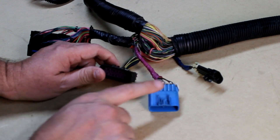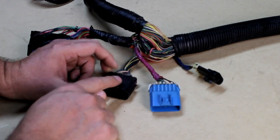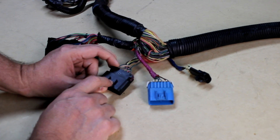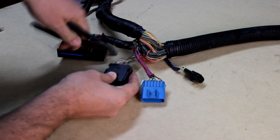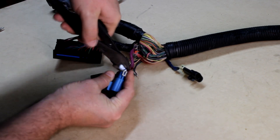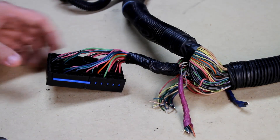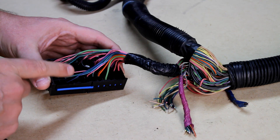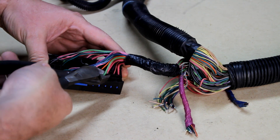This is called the C100 connector, this is C152, and this is C153. I'm gonna cut all these off the back. Those three or four wires on here I'll find them coming off the pin outs of my PCM connector, so I don't need to keep track of that — we're just gonna cut these off. Now on the C2 block that goes to the fuse block, we're gonna cut off all the wires that are not pink or orange. Those are wires we're not going to use, so let's get rid of those first, then we'll talk about the rest.